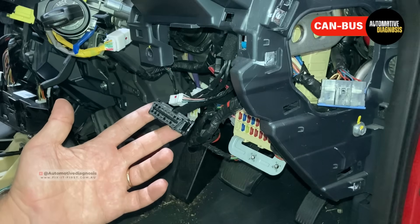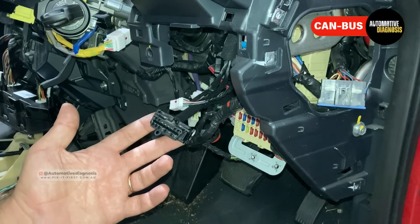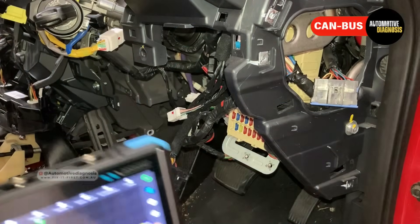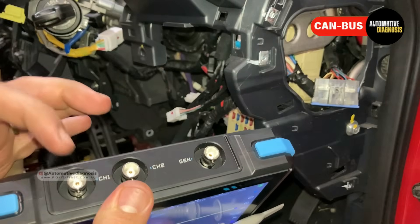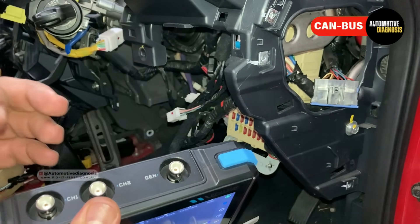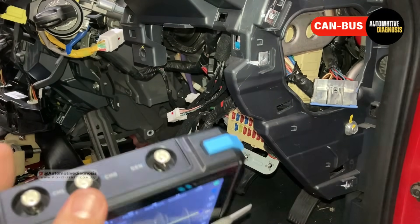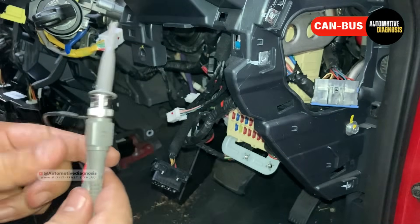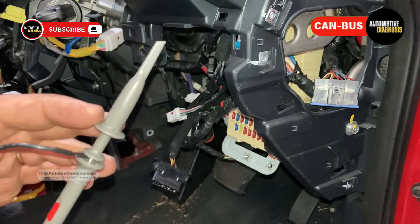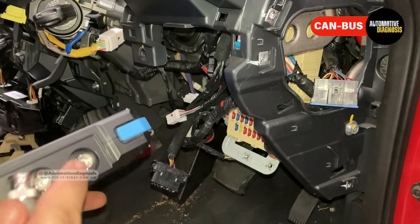Sometimes a multimeter is not going to help to identify the issue — reading the waveform of the CAN bus with an oscilloscope is going to be a great help. On the oscilloscope I have two channels: channel one and channel two. The good thing about this oscilloscope is having two channels at the same time, because on the CAN bus I have two wires. Having two waveforms at the same time gives us more flexibility for diagnostics. This end of the probe sits on the oscilloscope itself, and this tip picks up the signal from CAN high or CAN low.